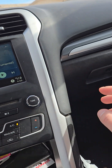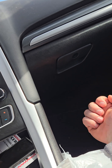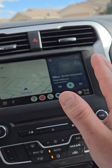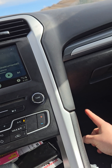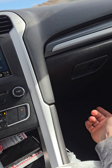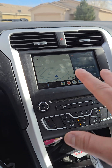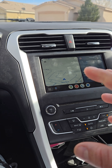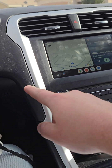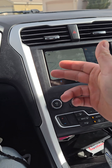In the Ford Fusion, I was able to put the CarPlay box underneath a little trim panel on the passenger side. You can pull it down and there's just enough room to stick it in there. The cables that go to it come out underneath the head unit at the bottom left corner of your glove box. You can tuck them all underneath so you can't see it at all. The microphone for Google Assistant — I'm not using it for calls, it's not good enough — is routed from behind the head unit out from the box under the trim.